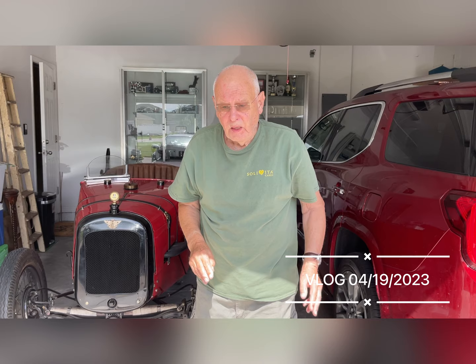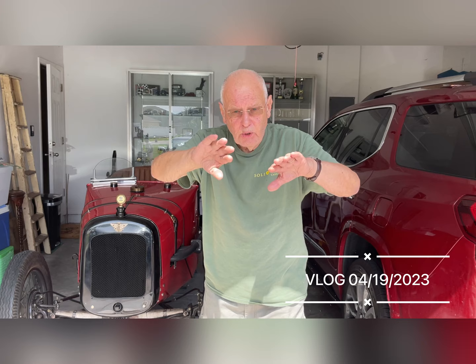The other problem with chassis stiffness is that under normal circumstances, the engine is bolted directly into the chassis. When they twist, or the rivets become loose, it twists the entire crankcase. You have serious problems because the back end of the cylinder block doesn't twist but the aluminum crankcase does twist, and so it's liable to break the back end of the cylinder block off the engine. I had that happen with one of my cars — a 10-stud block — and it broke the whole back end of the block off.